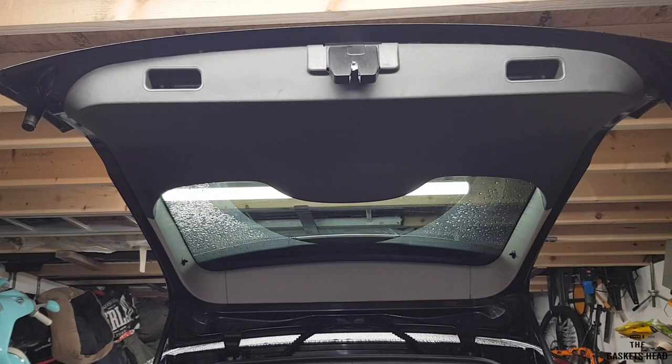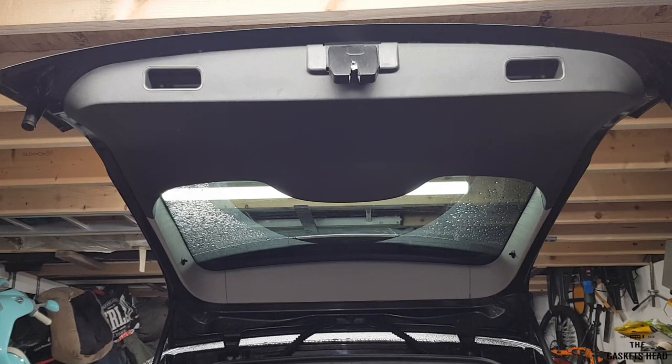Just before we take this off, I thought I'd quickly explain my process. With these, and any electrical fault, you should really start from the fuse all the way back. On this vehicle, if you check the wiring diagrams, basically two fuses control the left and the right-hand side door locks, and the tailgate runs off the driver's side. We know all the doors work, we know the tailgate opens on the key, so I'm happy there's no fuse issue.